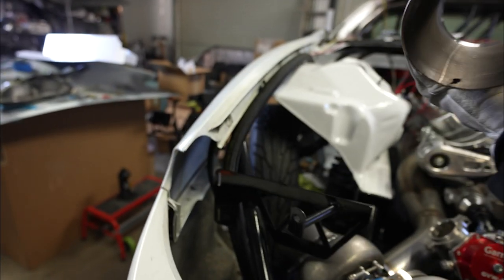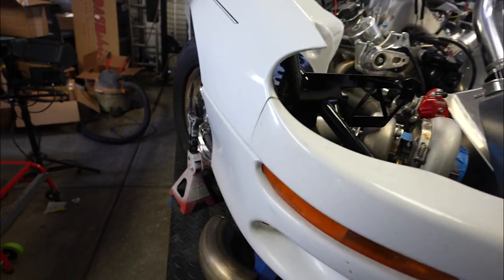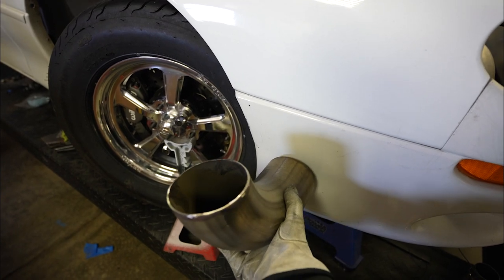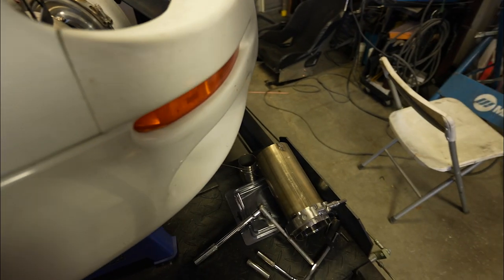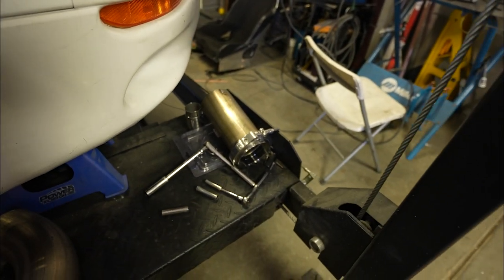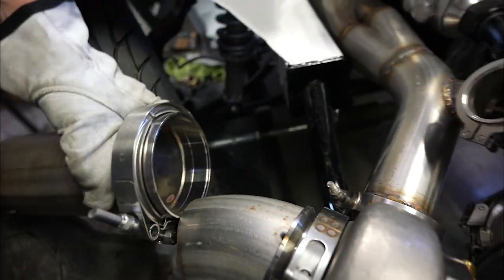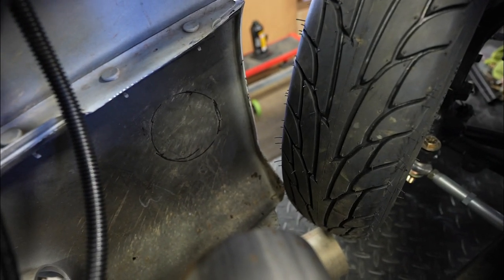We've got our piece tacked on, and when I set it in here it just barely clears the fender. If I cut my hole and slide the bullhorn in however far I want it tucked up against the body, that's how much I need to cut off. I'll take a few inches — maybe two or three — to suck the bullhorn into the car. What I did is flip the v-band around and project the tube out to the fender so I could mark out pretty much where the hole needs to be for it to come through.